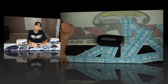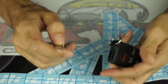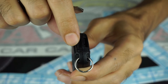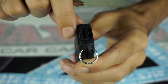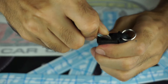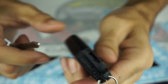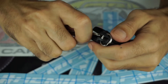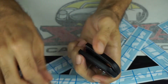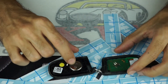Let's go ahead and get into this battery replacement. Take the key that comes in the fob — there are two holes here. The one you want is not the one the key goes into; it's the other one, which is just a shallow little hole. Stick the tip of your key in there and just pry like this. You can see how I pry there — just go along the sides — and there we are, guys. You have just opened up your key fob.